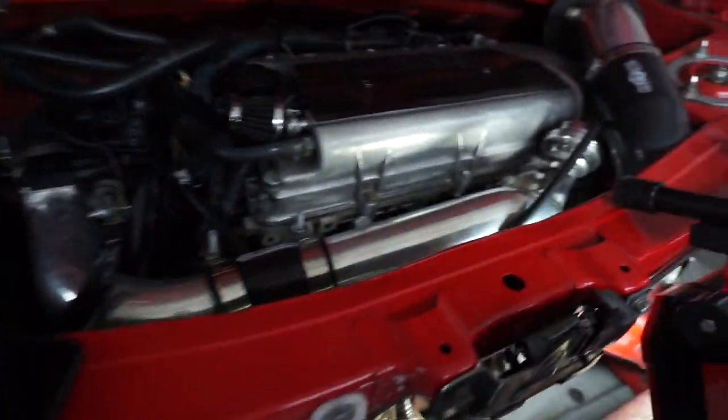I'm also gonna clean the side of this before I drain the oil and start the process of putting the new timing chain tensioner seal on. You can see it's dry now but I don't really know exactly where the oil leak is coming from. I could start it without the charge pipes — the 2ZZ will still run — and find if it leaks, but I want to drain the oil first.